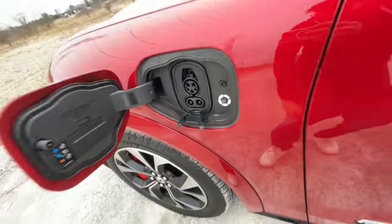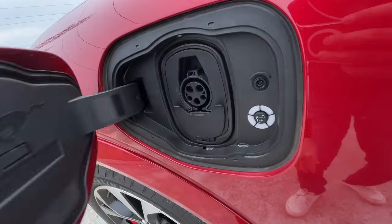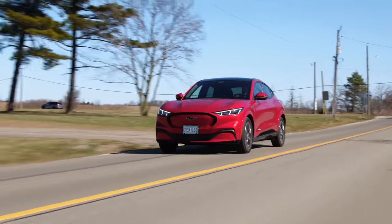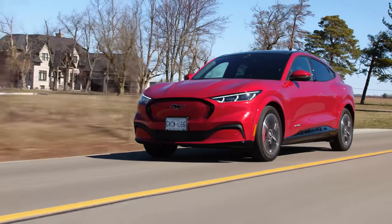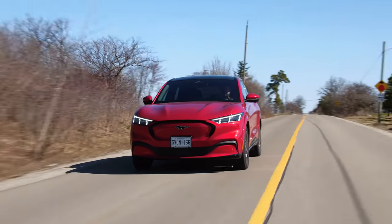Actual charge times: about 10 to 14 hours on level two, and about 45 minutes on level three up to 80%. That 'up to 80%' is very critical because it actually takes so much longer once you get to 80%, and you're not supposed to charge lithium batteries all the way to the end anyway. Which leads to my next rant: every manufacturer should be giving range figures from 80%, not 100% — because they give charging times to 80%, they give everything to 80%, so why don't they give the range from 80%?